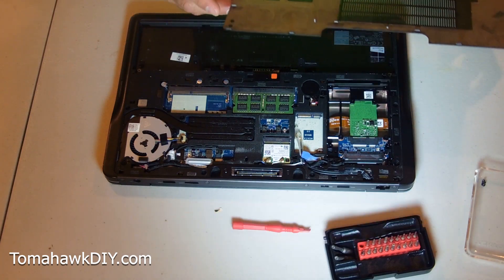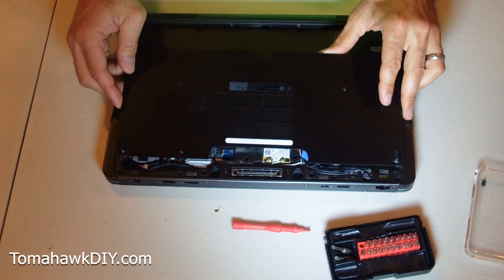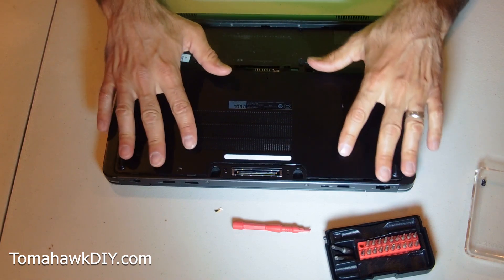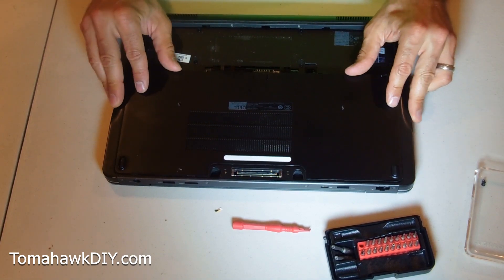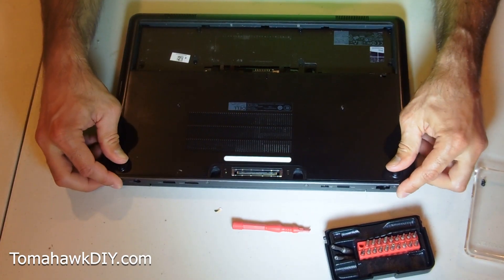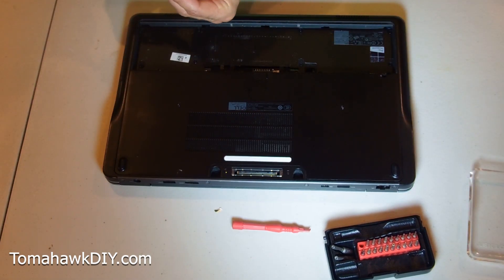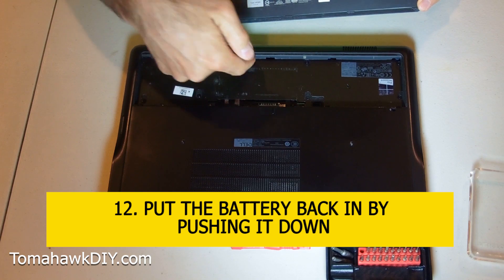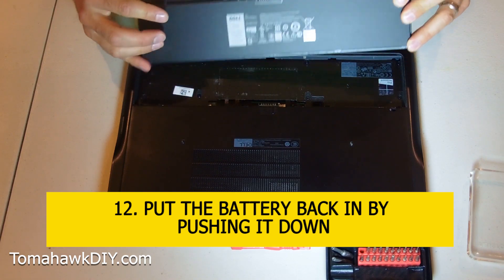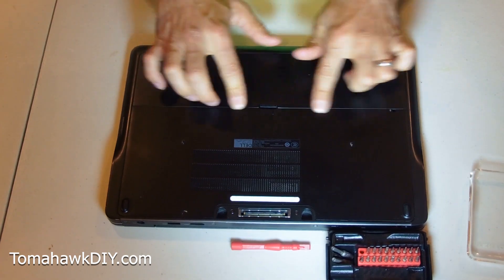Remember, look at your tabs and the direction they slide before you try to put the cover back in place. Line up the tabs - it should be sitting nice and flush - then just give it a little push back. We're going to loosely put screw one in and loosely put screw number two in. Putting our battery back in now - put this side in first and then push down on the pins here. Angle it in, push down, and it clips in place.